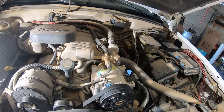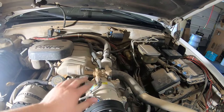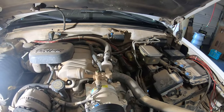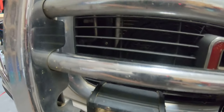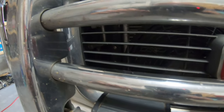So this is a 134A system. Like I said, replacing the compressor — he had a leak previously on his high side on the Schrader valve, so we're going to replace those. We're going to replace the dryer and the orifice tube, which is of course in the most pain-in-the-butt place to get to, way back there behind the headlight. So stay tuned, we'll show you how.